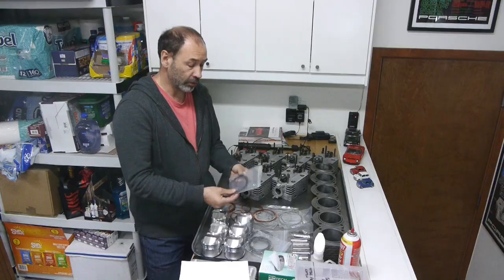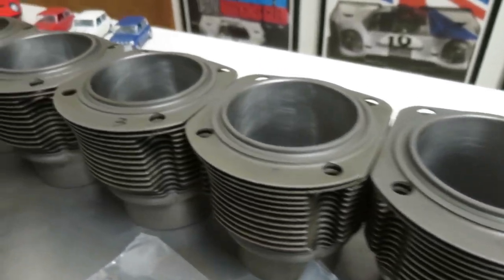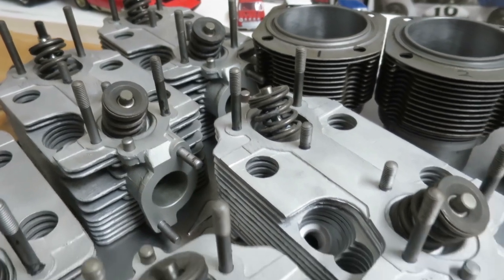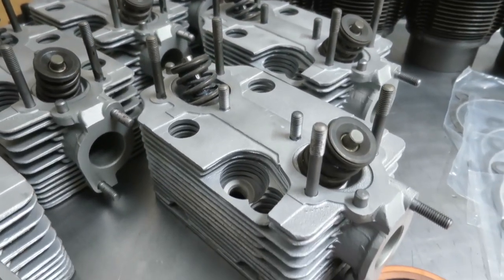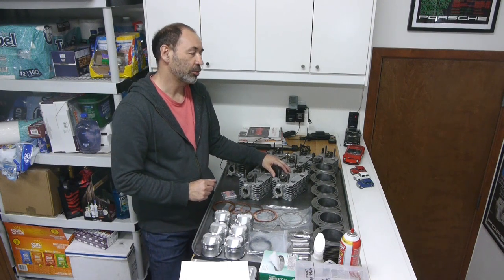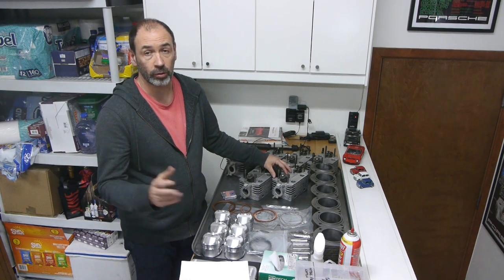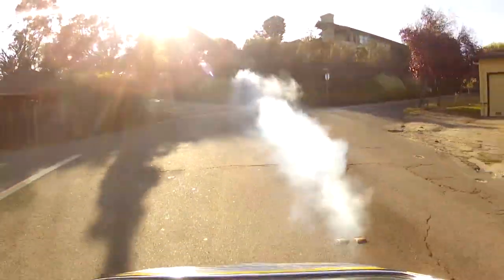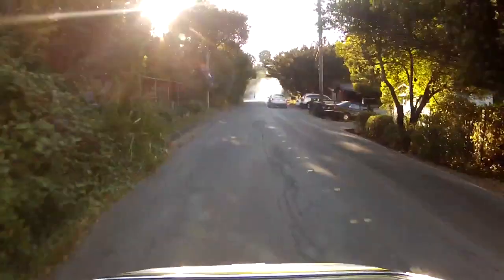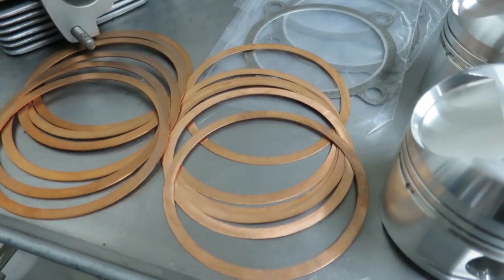The pistons came with their own piston rings, wrist pins, and circlips. I also had the cylinders bored to 81 millimeters to match the pistons. The heads have been gone through by Ted Robinson — he found the valve guides to be completely worn, worst he'd ever seen, amazed the car even ran. He cleaned up all the valves, installed new valve guides, and that was the cause of the blue smoke of course. I've also got new head gaskets, barrel gaskets, and one millimeter barrel shims.